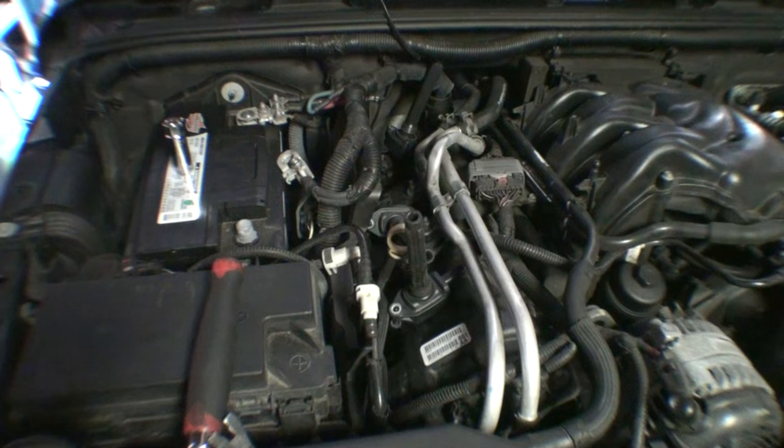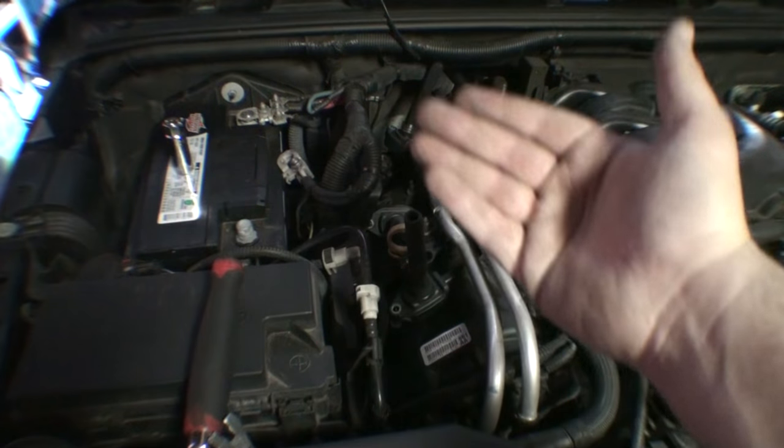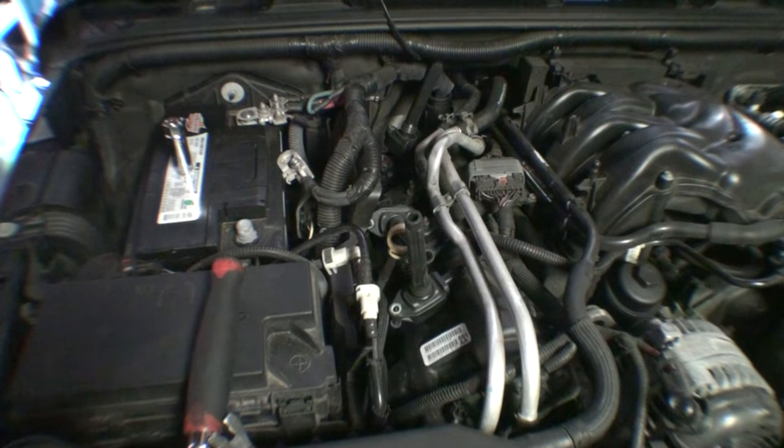A lot of fasteners you don't have to worry about the torque specification on, but spark plugs, I would absolutely make sure that you do this. Really, you don't want to over-tighten them, and you don't want to under-tighten them. If you over-tighten them, you could strip out the threading in the cylinder head. If you under-tighten them, the spark plug could literally pop back out, take all the thread with it. You'll be paying for an expensive repair of the cylinder head, which is not a good thing.